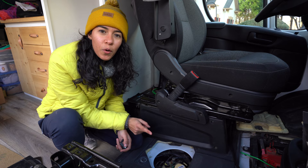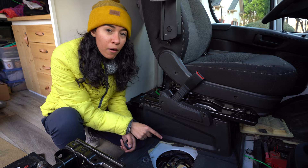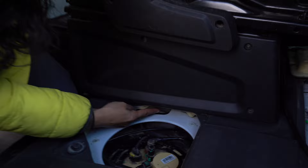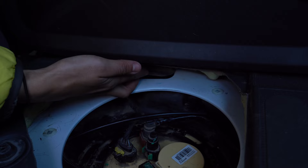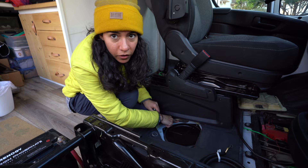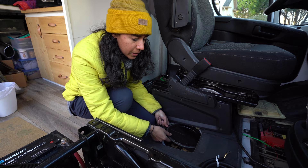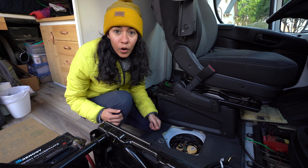We have a bit of a mice problem in our van and never figured out where they're coming in. We know it's somewhere up here in the front — we always assumed it was the engine. However, when we took this top off, we realized this little rubber cap was actually popped off and wedged under here. We're thinking they popped it off and were coming up through this hole, because this metal plate only covers one hole, not the other. With that gas line hole underneath, they could easily come up through there and in through this rubber piece that was popped off. We're going to do something to really secure it down.